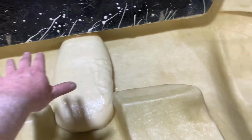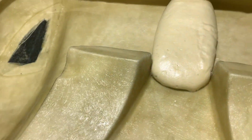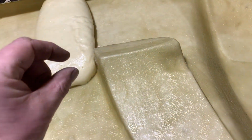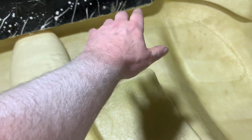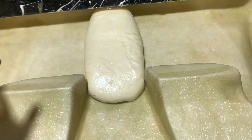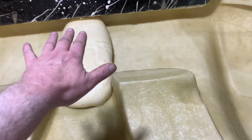And then we'll put core mat all the way across there, and then put the last layer of fiberglass over the top of that. So it'll produce a skin, probably about, you're probably looking at about 6 to 7 millimeter thick across there. 3 mil core mat, you can end up with about 2 to 3 millimeters of sort of fiberglass. Actually, with a double layer gel coat, yeah, it's probably close to 6 mil. So you have a 6 mil sort of thick piece across the front there, and hopefully that'll give us a bit more beam stiffness.